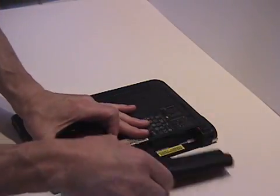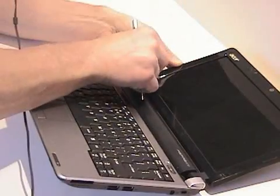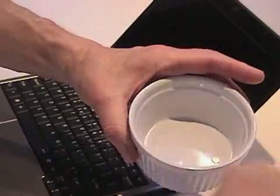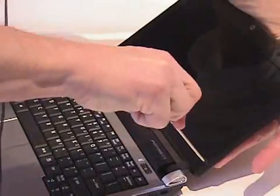Remove the battery from your laptop and remove the plastic caps that cover the screws at the bottom of the screen. This may require an exacto knife or some creativity. Make sure you save all the little parts. Then remove the screws at the bottom of the screen — a magnetic screwdriver is a big help.